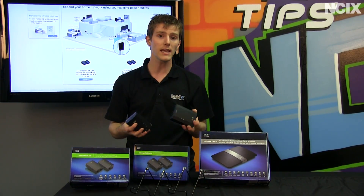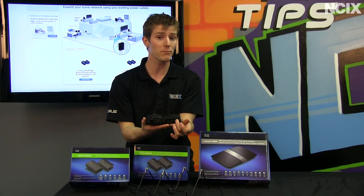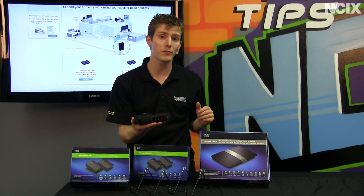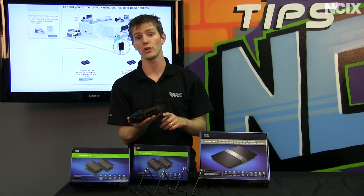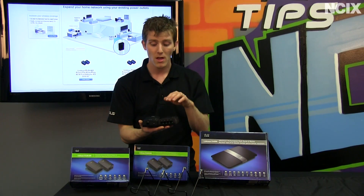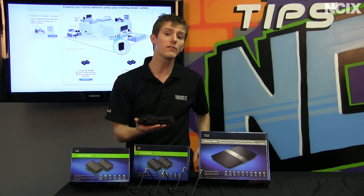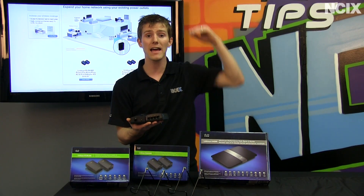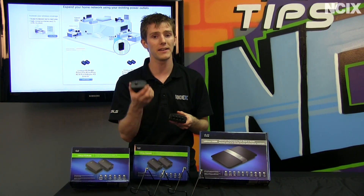The difference between the EK and the SK is that the SK includes one adapter that has a four-port switch built into the bottom. This is ideal for situations where at one end of your Powerline network you have multiple devices, such as you might find in a home theater where you've got your Blu-ray player, your smart TV, your media PC, whatever else is over there. The other one, the PLE400, only has a single port, so this is what you might use in a situation where you have a single computer in a basement or an attic, somewhere far removed from the rest of your network.